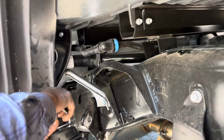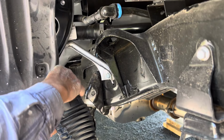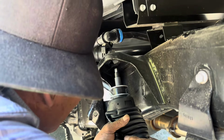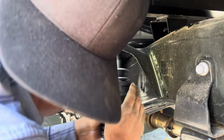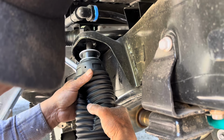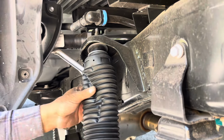Once this is done, go ahead and make sure all of your bolts that you disassembled are torqued down to their specified torque specs. Slap your tires back on and lower your rear end back down to the ground. Inspect the springs and struts as you lower the vehicle to the ground. Take your truck for a test drive and check over the entire vehicle one more time.